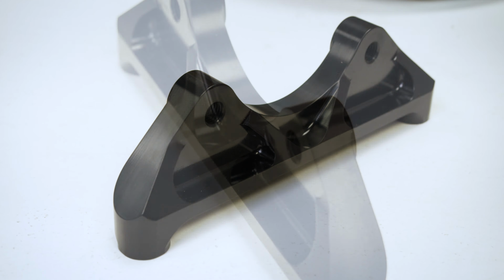Now, this one's important and a little bit of a bummer. None of the Brembo GT Big Brake systems are going to work with your OEM front 19-inch wheels. These OEM wheels are bulky, they don't have the barrel or the spoke clearance to fit these systems, not even the 350mm rotor version, which is the same as stock. That caliper is too big. So you're going to need aftermarket wheels.